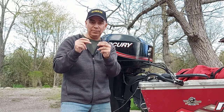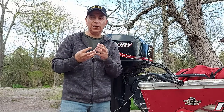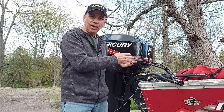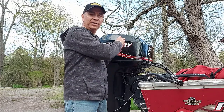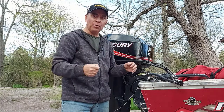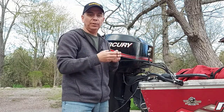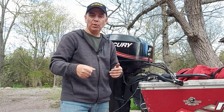It broke down into a bunch of pieces and traveled up to the fuel filter, really clogging it up, and that's what was happening — the motor was starved for fuel. My theory is when I would shut the engine off, all that sediment from the fuel liner would travel back through the hose and sit there, and then once I got going really good it would suck the fuel back toward the fuel filter and cause a jam, clogging it up again, and that's why it would sputter and want to stall.